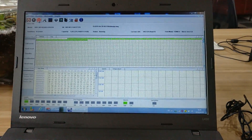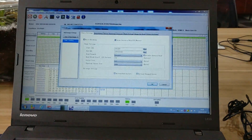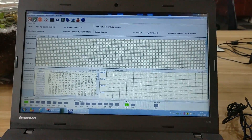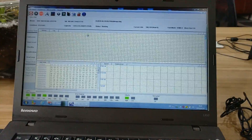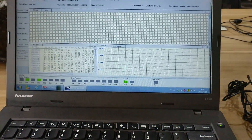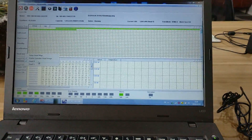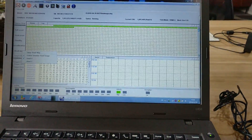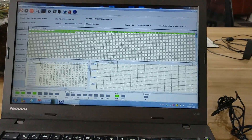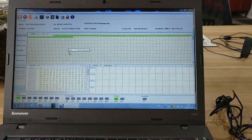It is very slow, so we can click Stop and bypass more — increase the bypass range, then click Start to continue imaging. Here is the data area. After we finish head 0, we open head 1. We need to open head 1 from the RAM first. This is the way to recover the lost data from a scratched hard drive. Thank you for watching the video.